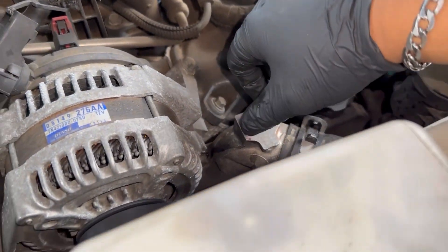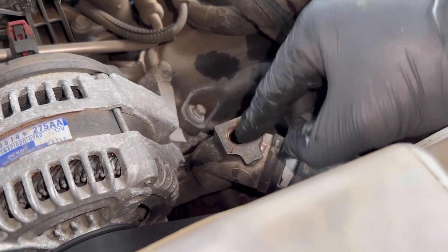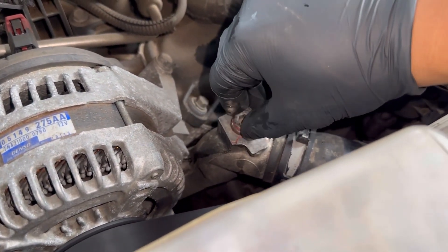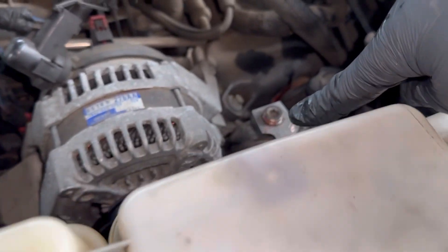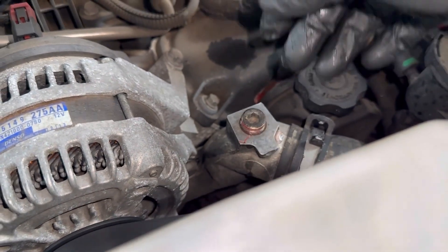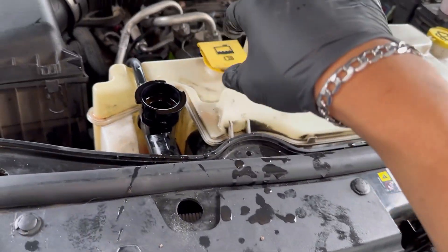The car is running and warming up. I actually took the whole reservoir out and started filling it up with antifreeze in there, then slightly closed it back up. Now go ahead and fill the reservoir with new antifreeze. You're going to see it going up and down, and then you'll start seeing air bubbles come out — let it bubble on its own, and when it stops you can close it back up and top it off.